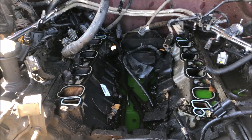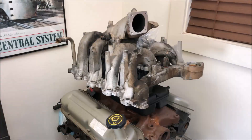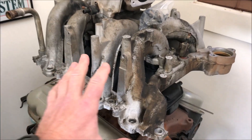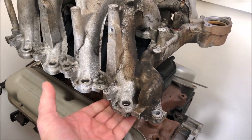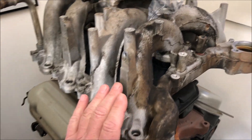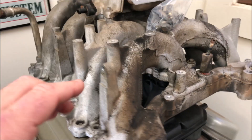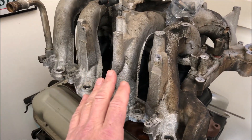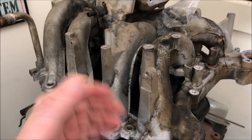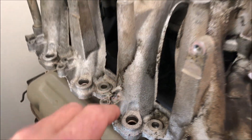It's going to be a pretty cool project. The nice thing about aluminum is that I can port it. I'm going to port and gasket-match these intake runners to the head, and I'm also going to polish every one of these runners going down into the plastic lower to ensure smooth laminar flow — that's smooth flow versus turbulent flow caused by casting irregularities.